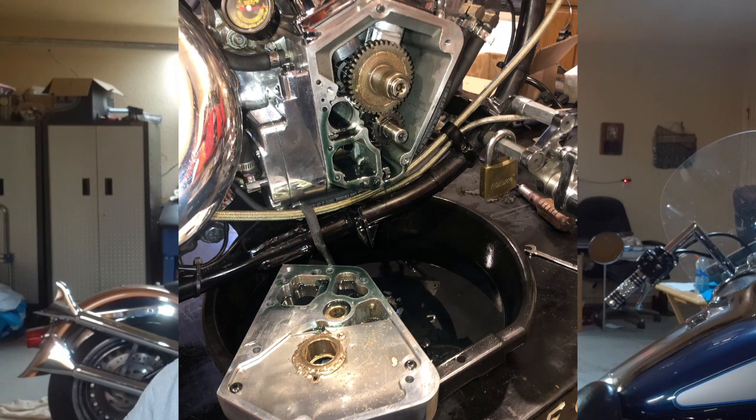I'll give you a little bit of history here, because all of this stuff runs hand in hand. When Harley Davidson finds something that works, they stay with it forever. The twin cam was probably the biggest change in motors since 1936, when they came out with the knucklehead. Prior to 1936, Harley Davidson did not have oil pumps — it was a gravity feed that flowed down through the engine and didn't circulate the oil. The used oil would just drop onto the ground.